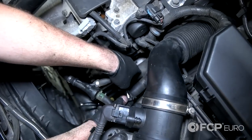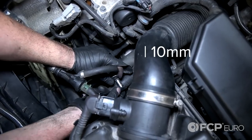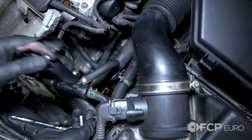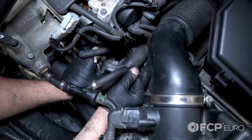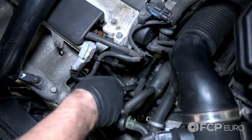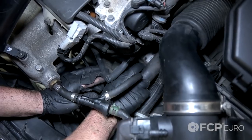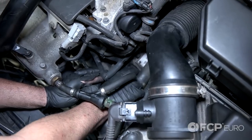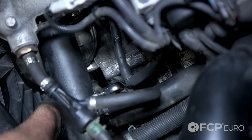Next, there's a wiring loom here — it has a 10-millimeter nut, go ahead and remove that. Now remove the bracket. Next, there's going to be the two mounting bolts. This one's already loose — that broke free when we were removing the nut for that bracket as the two were stuck together. Now last, get that bottom 14-millimeter starter bolt.